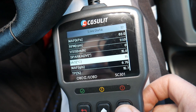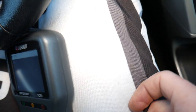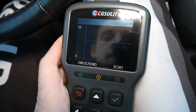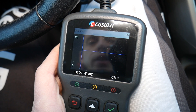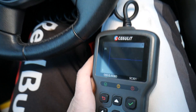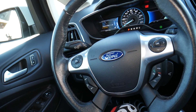You can see the engine is warming up and the reading climbed to 15 degrees now, because it's sucking slightly warmer air from under the hood. That's how you test the intake air temperature sensor on a Ford C-Max, Ford Fusion, or Lincoln MKZ. Hopefully the video was helpful — thank you for watching and see you next time.